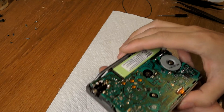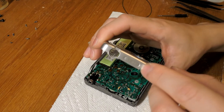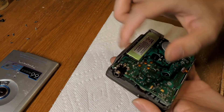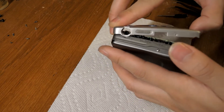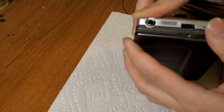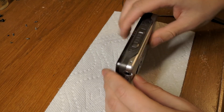In the video I didn't show it, but I demagnetized the head and cleaned everything — this is just a belt replacement tutorial video. Once you finish that, start putting everything back together. Flip the hold switch up, because on the board there's a little notch that protects the switch from breaking. When you put the case back on, make sure the hold switch is also up — hold it with your finger, align it, put everything back together, and screw it in place.